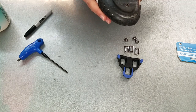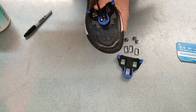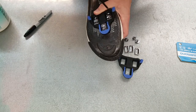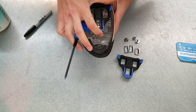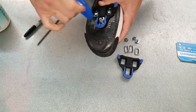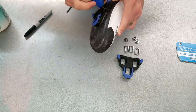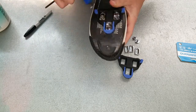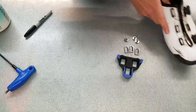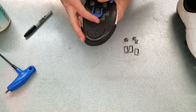We've got these on here now and everything is lined up. What you'll want to do is go ahead and start to snug these up slowly and work your way around as you start to tighten them down. If you tighten one bolt all the way — especially the top one — it will often twist the cleat and mess up the alignment, so you'll need to start over. Snug them all down just a little bit to start, then come back through and tighten them all down again. That first shoe is done; we'll move on to the next one. We've already got everything greased and the backing plates in the cleat. If you find a lot of resistance, go ahead and back that screw out and make sure it's threaded in properly.